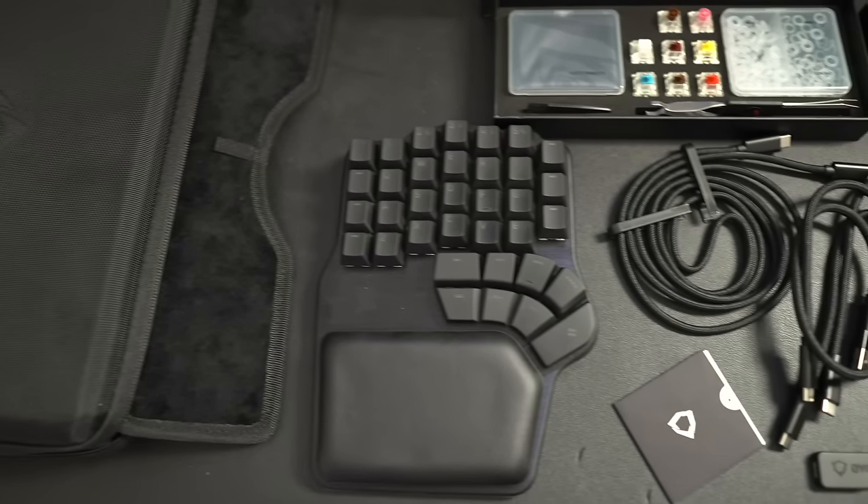This model has black ABS laser etched keycaps. The legends are visible without lighting but quite subtle, so if you want distinct legends you'll either need the lighting on or a different keycap colour. Personally I prefer a rougher PBT texture as ABS will shine over time, but plenty of people will prefer the smooth feel and sound. The standard MX keys can be replaced easily, but the thumb cluster keys are bespoke moulds — Digma has released the files so you could print your own, but they'll be far harder to source than standard keycaps. Also, there are no extra homing keys for alternative layouts like Dvorak or Colemak, which I'd have preferred over the extra O-rings and test switches.